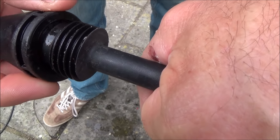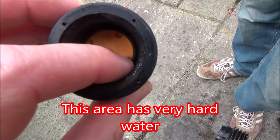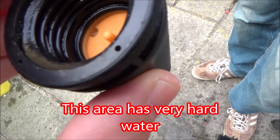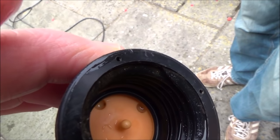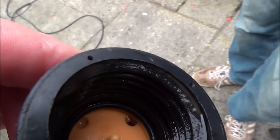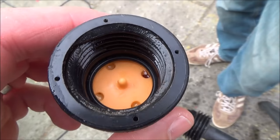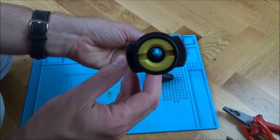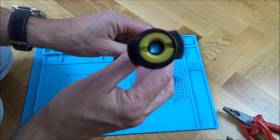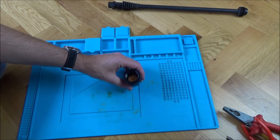It does look a little bit scaled up. Taking it inside now - looking in here immediately it looks like there's something in there. There are tiny little holes and I can see on the edge of them there's a little hole at the nine o'clock position, and spinning it round there's another. There's some gunk in that one, so maybe it's just scaled up over the years. Looking at the lance itself, it's just a through hole - it's just a pipe, so 100% it's nothing to do with the lance, it's all to do with this end bit.